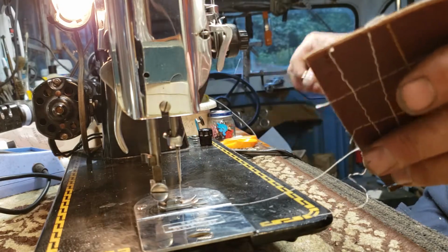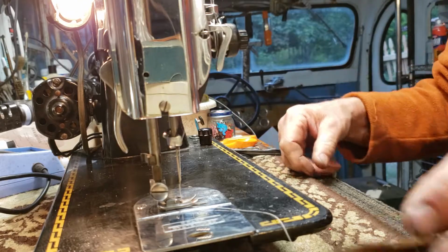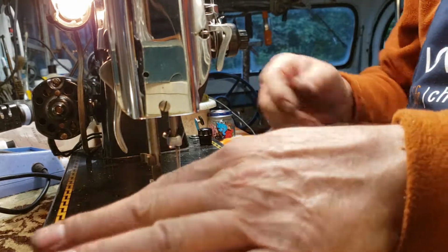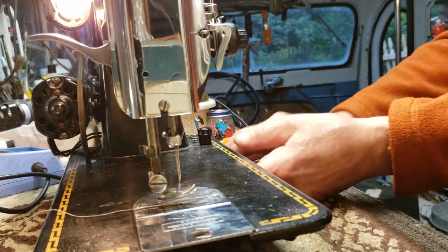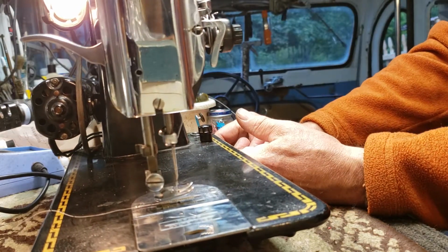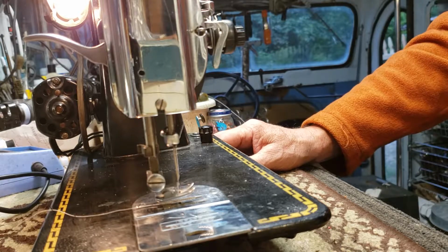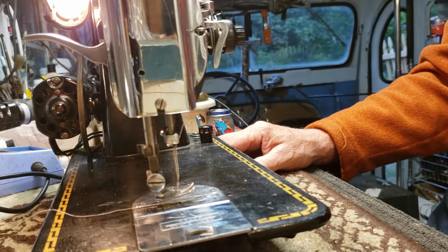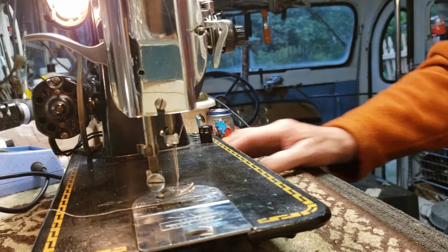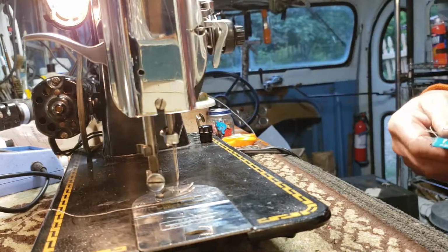I put a strong motor on her. I put a 1.4 amp motor on your Singer 201 and 1591, some of the strongest and best of the Singers have a 0.6 amp motor, and some of the Japanese machines have a 1 amp or a 1.2 amp, and this is a 1.4 amp, so it's decently strong. Don't have any thick thread to use